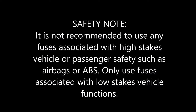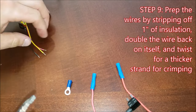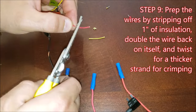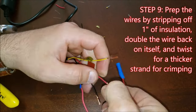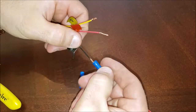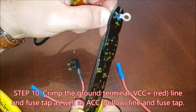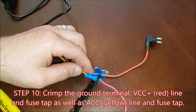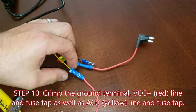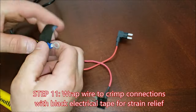Now let's prepare our wire leads by creating our wire harness to tap into the fuse box. We're going to be adding the fuse taps, but before crimping them we need to strip excess insulation to be able to fold the wire back on itself and twist, so that we can make the gauge seem heavier to better grip the crimp. Here we're crimping the ground to the black wire, the VCC positive to its fuse tap, and the ACC to its fuse tap. We'll follow up with black electrical tape wrapped around the crimp connections for strain relief and tidiness.